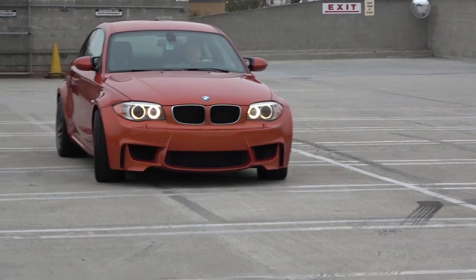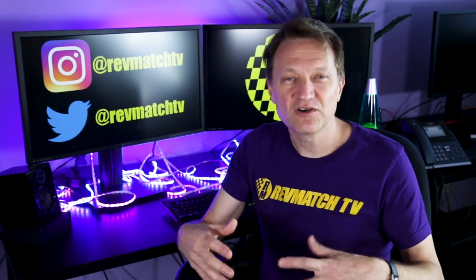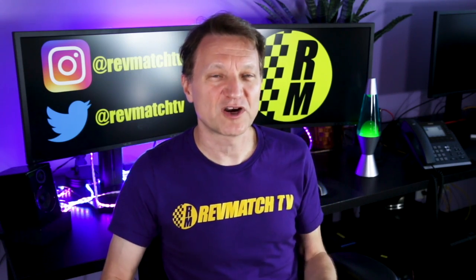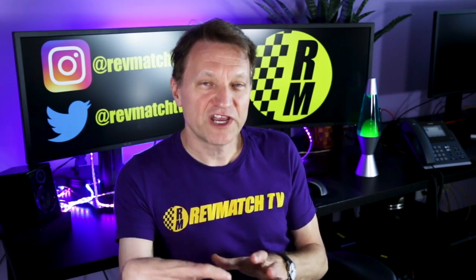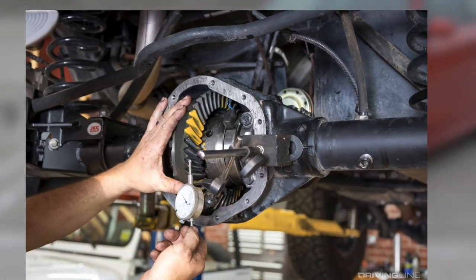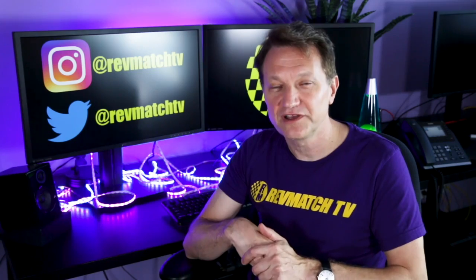And this, number five, is the bonus torque mod. You've ridden a 10-speed bike — if you're on a bicycle and you try to go up a hill in the wrong gear, it's going to be really difficult because you can't apply enough torque. Your power output as a human is pretty consistent, maybe one-third of a horsepower, but if you're in the wrong gear it's going to be really hard to go up the hill. So you move your chain to a bigger cog, because that gives you more rotational torque to the rear wheel. In a car, if you move to a lower gear ratio, that's actually going to give you more torque to the rear wheels — just like going up a hill on a bicycle.